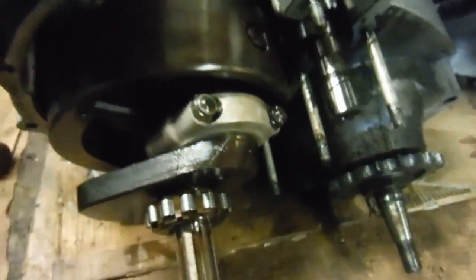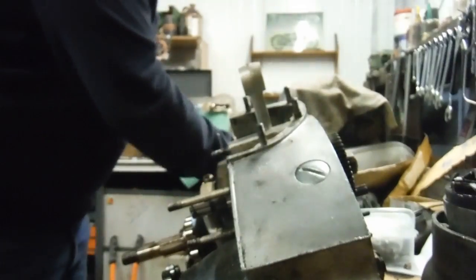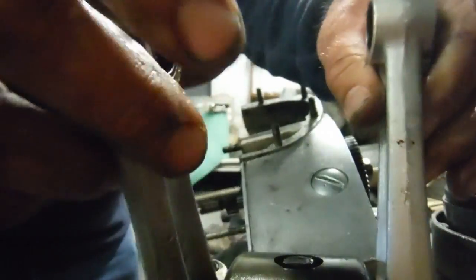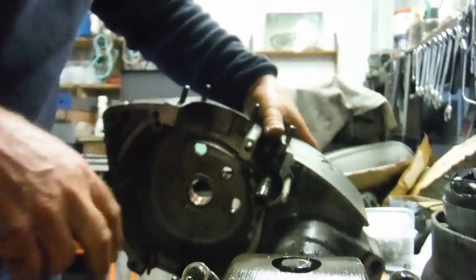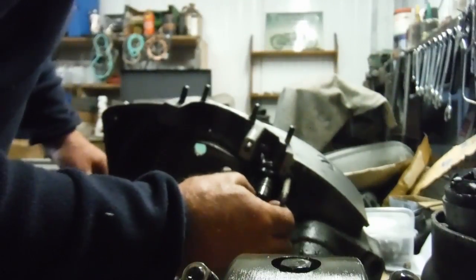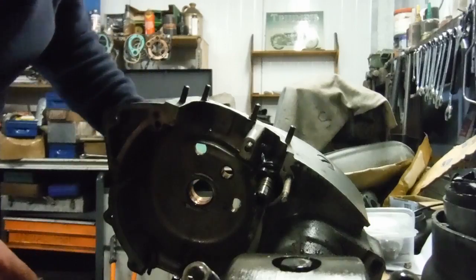Next step should just be a matter of me sliding the crank out. I'll get this drive-side case out of the way for the moment and pull the crank out. There it is. Obviously there's a little spring and a disc from the crankcase breather that engages with this end of the camshaft — that should be in the drive-side case, so I'll look out for them and put them somewhere safe. There's the timing-side bush.